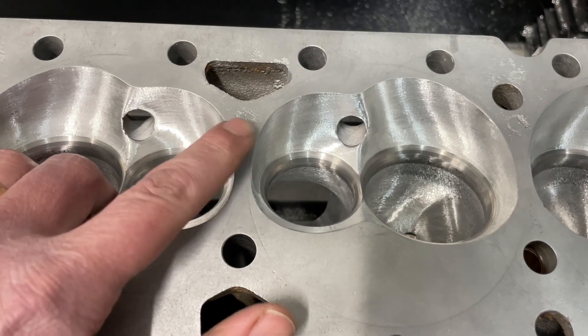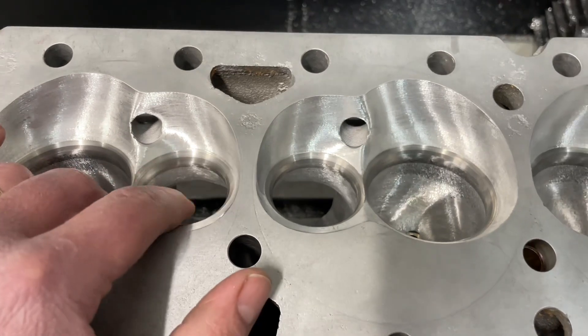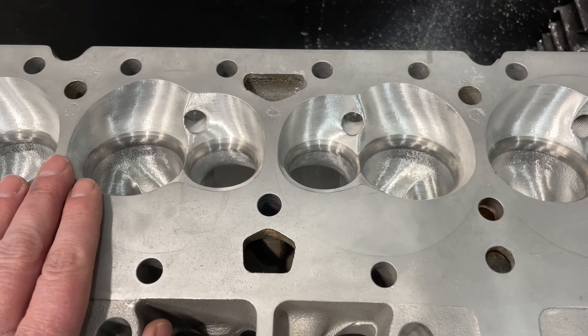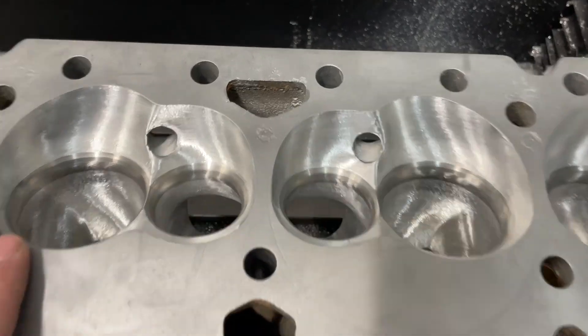It happens partly because there isn't a good ground, so it's easier for the water to react with the aluminum, causing oxidization that pulls off the aluminum. So a small tip: run grounds. What I mean is you can run a ground from each cylinder head down to your chassis, and another ground from the block all the way back to your battery. Just a little helpful hint.